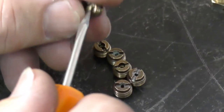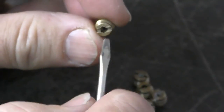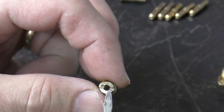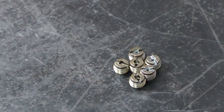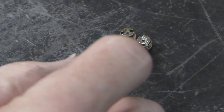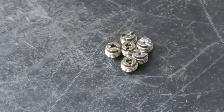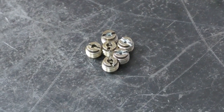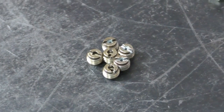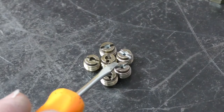We'll do the same for our air correctors. Air correctors have their size marked on them, but once again on a 50-year-old carburetor, never believe the marking — always pin fit it. These are marked at 180. Very few people will drill these, but I have found them drilled before. Most times if they're not too torn up, you can reuse them as long as the slot isn't really beat up. However, a couple of years from now when everything's corroded over, if the slot is broken out there's a good chance it will break off in the top of the carburetor. Brass ages, and you don't want 50-year-old brass snapping during routine maintenance — if anything looks damaged, replace it.